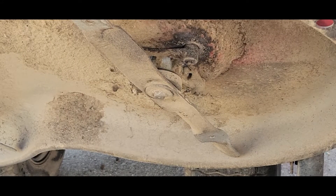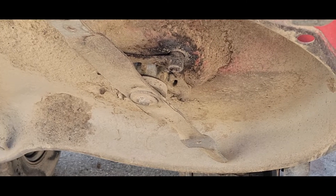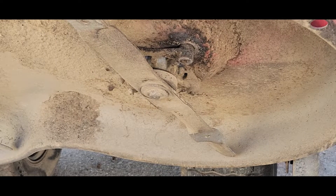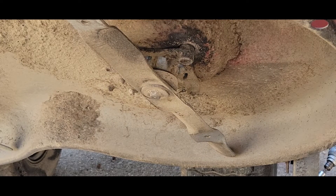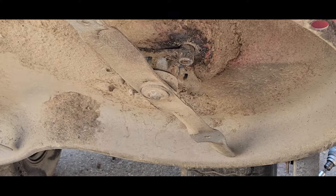I'll set the torch on there, about three or four minutes on each one, then try the bolt and do that a couple times. I heated the top one up — it didn't want to move at first, but after heating and letting it cool down I got it to budge. I put a swivel on the half-inch socket. See how hot that is — now the bolt's kind of warm. It came out nice. I recommend anti-seize — these things should go back in with anti-seize. When you have dissimilar metals like aluminum or magnesium, it'll corrode onto them.